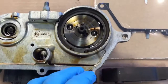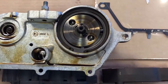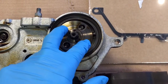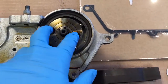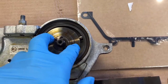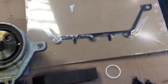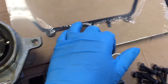In this picture we haven't got the Beeson system drilled oil pump disc, but that's something that will be fitted in all of our repairs. It's a re-drilled oil pump disc that will have two opposing holes which will be slightly smaller, giving around 0.1mm clearance where the drive tabs go in, so there's not so much slack compared to the factory ones. Not pictured, but it is something we put into our repairs.